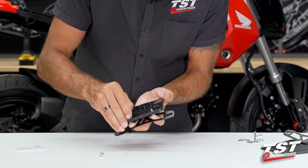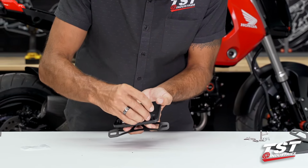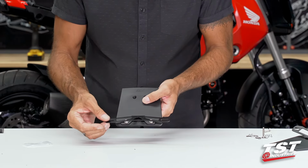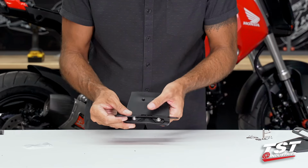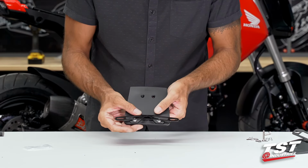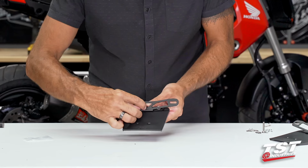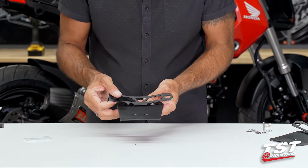cap it off with a nut. These nuts will not go all the way to bottom out because they do have a nylock locking element in them. We will have to apply tools here. There is adjustability here because this bracket is slotted. It is meant for fine tuning. So my easiest method of centering this on the undertail is to look at the vertex of the inner triangle here and line it up with the hole I've made.